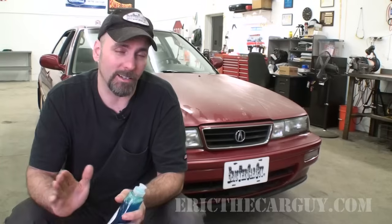I will say that if your catalytic converter is broken apart on the inside — say the substrate, the ceramic is all broken up — this isn't going to mean anything to you. This is only if you're getting a P0420 code and you want to try something before you spend a lot of money on a new catalytic converter. This might save you. I don't even know what these results are going to be, but I'm going to check the catalytic converter both before and after the cleaning and we'll see what results we get — as scientifically as possible.